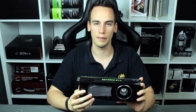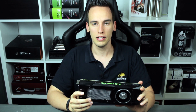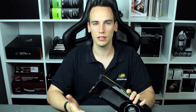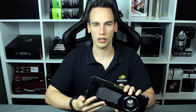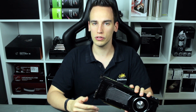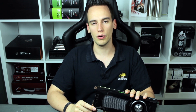I don't only have one card — I have four cards in total, so we will also do quad SLI and see the benefits. Even nowadays after Nvidia's promotion of two-way SLI and the new high bandwidth SLI bridge, you can still use quad SLI with four cards not only in benchmarks but also in games. We will do a quick test of how games scale with multi-GPU, looking at scaling from two cards to three cards to four cards.